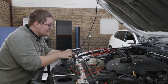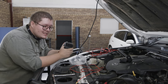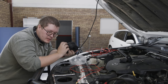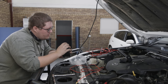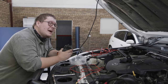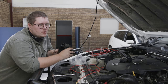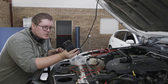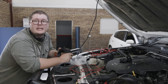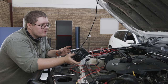Another task while I'm here at Rev House is to run a second set of cables to the back of the canopy, basically for my air compressor. You need to run a really heavy gauge cable — the same as running a dual battery system — because my air compressor uses 45 amps, whereas my National Luna DC-to-DC charger uses 25 amps. So it's even more important to use a solid gauge cable, put sleeving over it, and use a nice powerful inline fuse. We've got a 60-amp inline fuse, running these cables from the front all the way to the back.